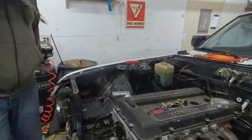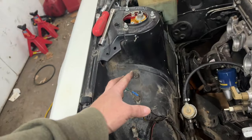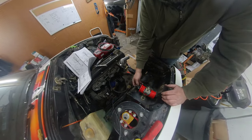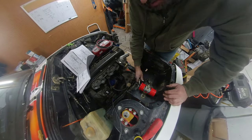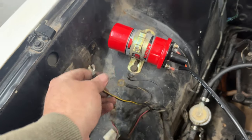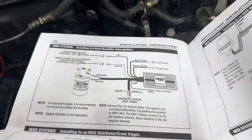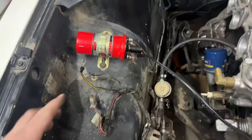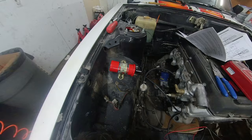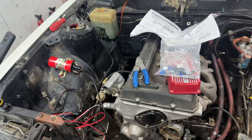There's a lot less here now — so that's good. Let's see what we can do about putting an MSD coil back in place and looking at the box. We've got the positive and negative hooked up there, and I believe this is the original positive and negative to the coil. We're going to wire up those to the red and the white, and then run the heavy red and the heavy black back to the battery. I think I'm just going to go ahead and snip-snip, crimp-crimp some stuff on, make some connectors, and then we'll be ready to talk — though the battery tray is a whole other issue.